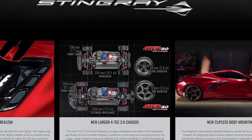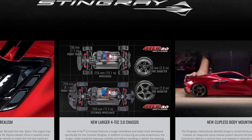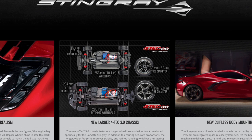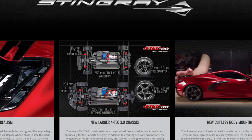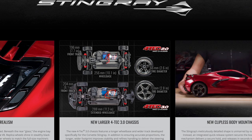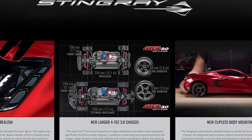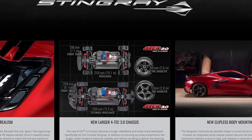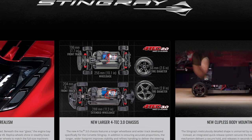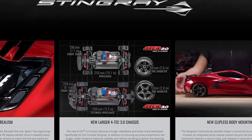The body looks like it would be great. You may have to remove the rear end — for example, I've done 70 miles per hour with a Mustang body, but I had to remove the rear clip off the body and then install a wing. It was actually a wing off of a buggy with two spacers. I took the front body posts from a Slash four-wheel drive to put the wing up high. That's the only way I was able to reach that speed without flying with the Mustang body.